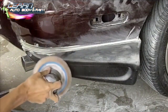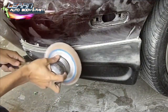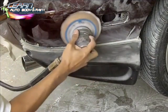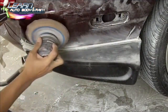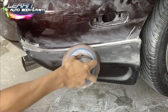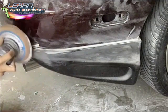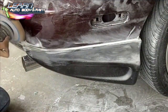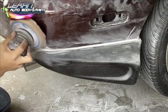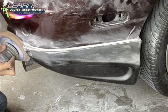We're doing the same technique here that we did on the rear spoiler — just hitting off all the high edges of the epoxy on our bottom body kit and on the bumper cover, just to save us some time instead of doing it by hand. Just hit it all down with the DA if you're comfortable with it. Get it all flat; don't stay in one spot too long because you'll start to cut the body kit down since it's fiberglass and 80 grit cuts through it pretty quickly. We're getting it down nice until we're left with a little U-shape area inside, then we're going to go over with more epoxy with our finger to finish it off so we get that nice U-shape.